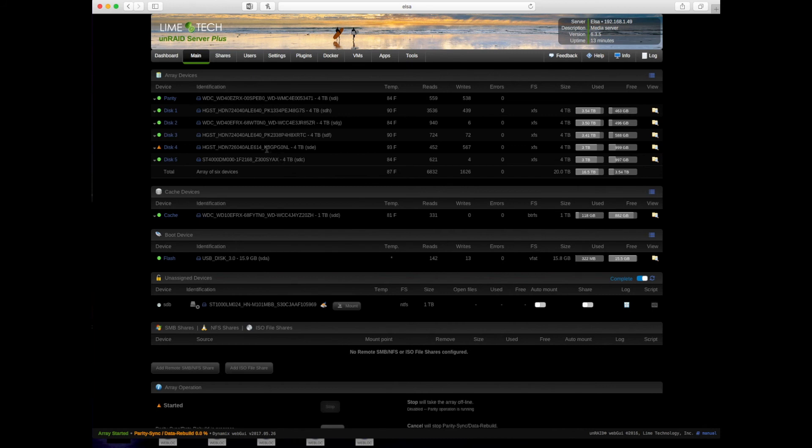All the information you once had on this disk, you can still access — that's kind of magical. The drive's empty but it's going to act like all the data is still on that drive, so anything you had on there you can still access during this rebuild process. Right now you're 100% up and running and operational — you can read data from this. If you're using it as a media server, you can go play movies off of it and it'll work just fine. You just have to wait for the rebuild. The biggest concern at this point is you don't want to lose another disk until this one's done being rebuilt, because if you do, you're going to have to go to your backup to restore at least some of your data.